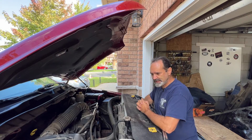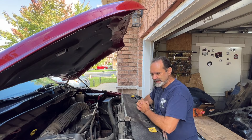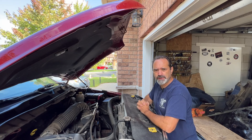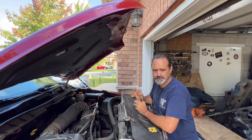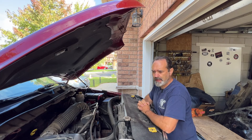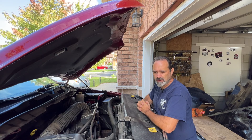As you probably know by now, this is my 2010 Dodge Ram 1500 with the 5.7 Hemi, 300,000 kilometres. The faults I am getting are engine fault code P0305 and also multi-cylinder misfire. The P0305 is specifically a cylinder 5 misfire, and it's very specific to cylinder 5.